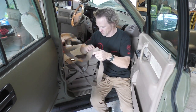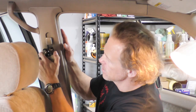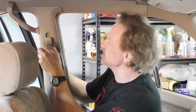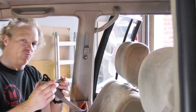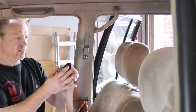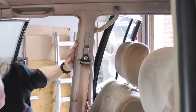While we're waiting on this to dry, there's nothing preventing me from putting this piece back together — just want to make sure you don't get it twisted. Back to factory spec, as Erico would say. These two little pieces snap right in there. The way this went, if you guys have this come off: the bolt goes through first, then the lock washer, then the regular washer, and then the retainer ring — just like so. We'll put our little plastic piece on and there we go.